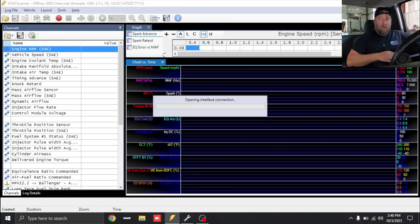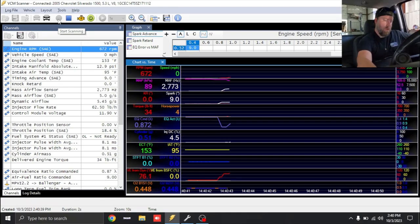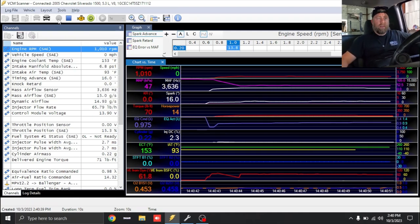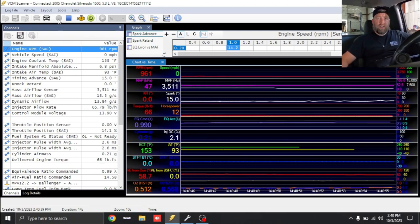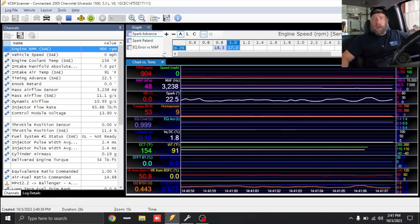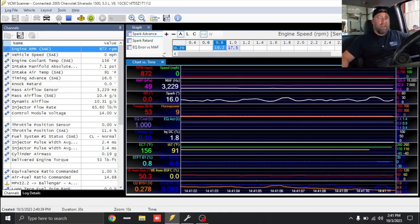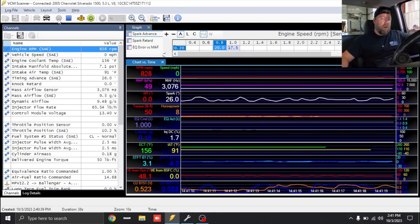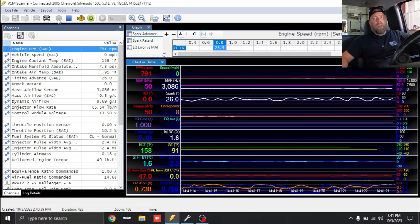Back in the truck. Getting logged into the scanner. With the ECU having been pulled, I have a feeling it might do the cam sensor issue again. It actually started right up. I'd almost bet money this truck has an aftermarket cam sensor. Get your sensors only from AC Delco or GM — an aftermarket cam sensor will cause intermittent long crank time and that single pop. Sometimes it won't even throw a code. This truck hasn't thrown a code yet and it's not doing it all the time, so I'd bet it's got an aftermarket cam sensor. The customer will need to replace it with an OEM, junkyard, or AC Delco/GM unit from Rock Auto.